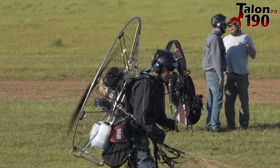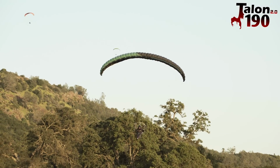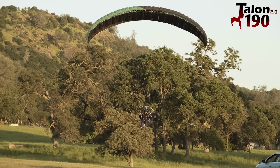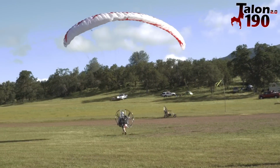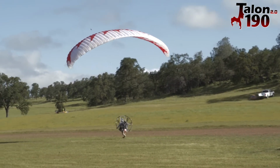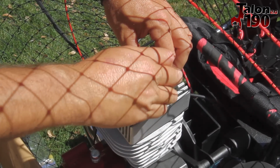Most paramotor engines on the market today run too hot, particularly when you're using the smaller gliders that are being used today. A smaller glider means more RPM to maintain straight and level flight. A smaller glider means that the pilot will be on the throttle harder and longer for climb out. All of this combines for increased excessive heat that we would really rather not see. The companies are not spending the time to design a motor that gets rid of the heat.